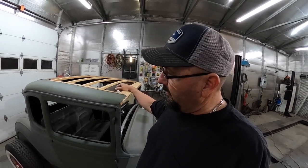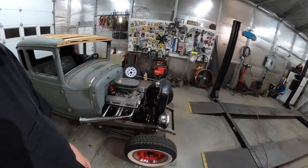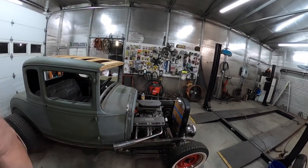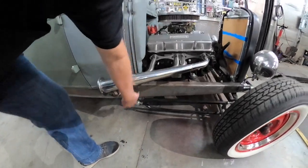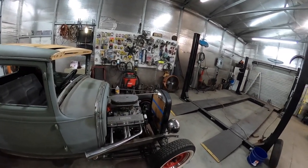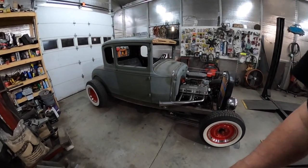I think it's going to turn out looking pretty decent. I can't wait to start getting the body ready to paint and the chassis. The other thing I did — I lowered the grill shell and the radiator on it. I did a little mini channel right in here on the bottom and let it drop over the edge of the frame, about three-quarters of an inch. Once it runs out to the front, it's even more so. I went and raised the mounts on the radiator and lowered my grill shell. Got it now where it looks more in proportion.